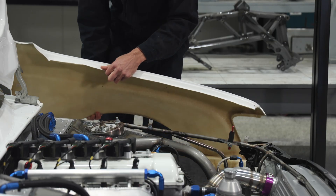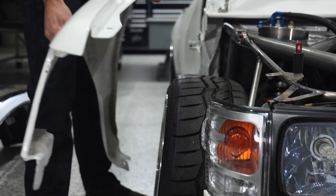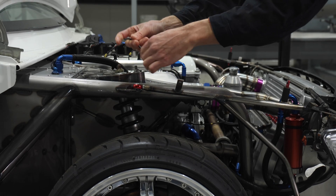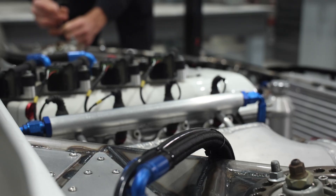The front guards use four M6 screws on each side that require a 10mm spanner to remove. The removable front end uses four allen key bolts and it houses the grill, headlights and ducting to the intercooler.